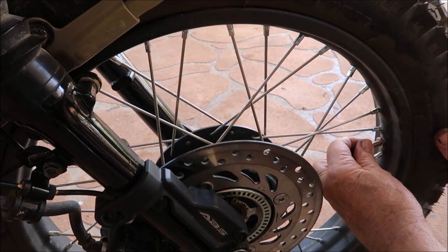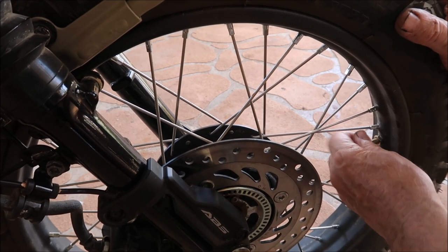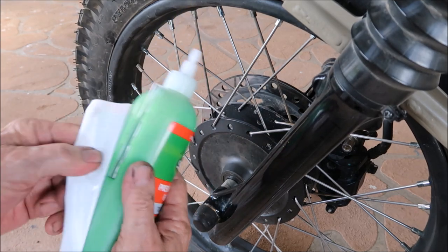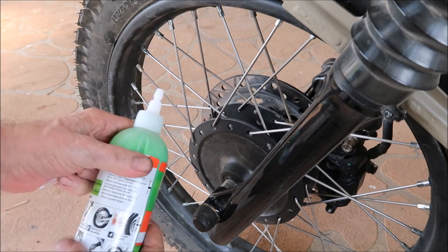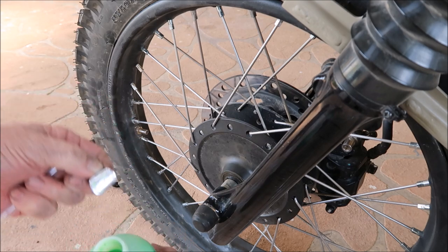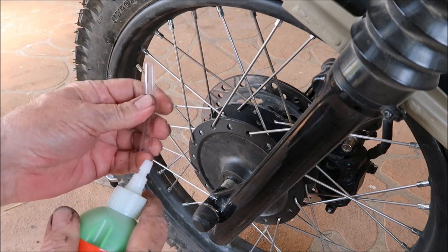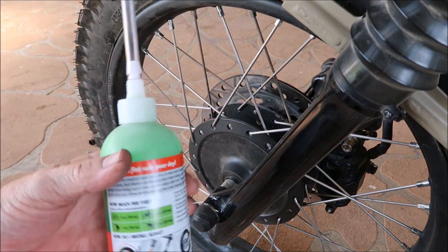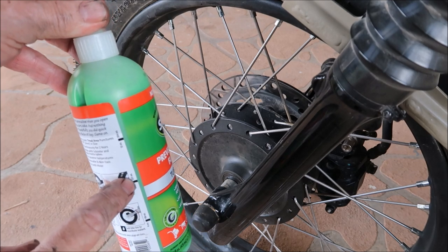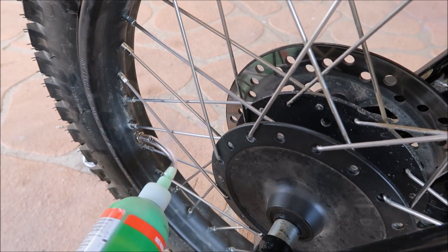They said make sure you remove all the air from the tire first. So she'll be down a bit now and we should be able to peel this off and get the valve out. I've already given it a bit of a shake - not sure if you're supposed to or not, but I did a pre-shake on it. Then slide this right down. Looking here on the side of the container, it shows the Slime level for doing two bikes, so I only have to bring it down to halfway. I've been told these are pretty messy, but we'll see how things go.